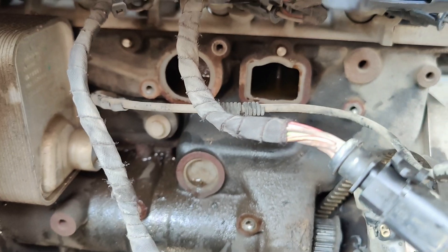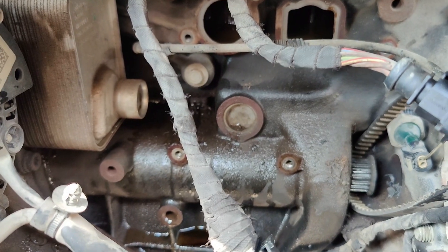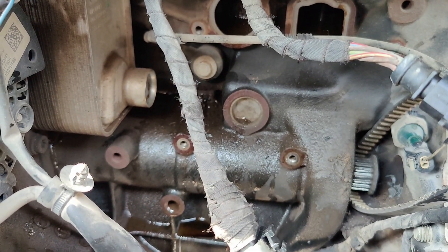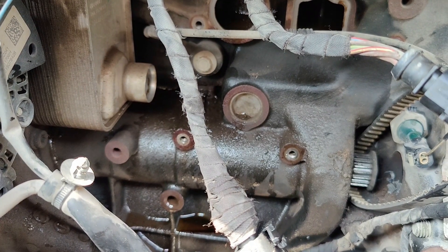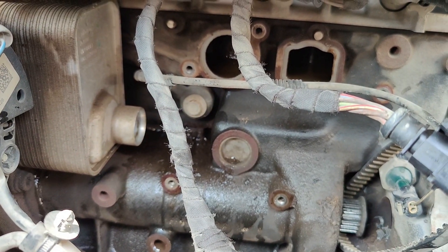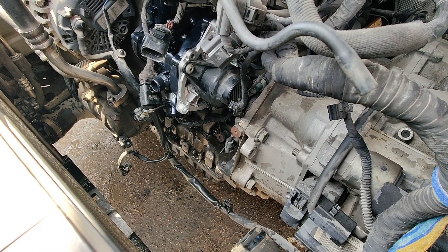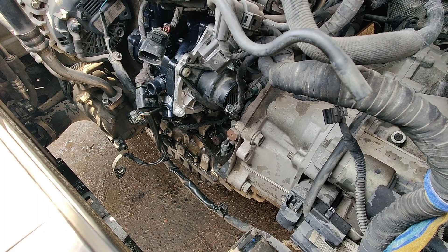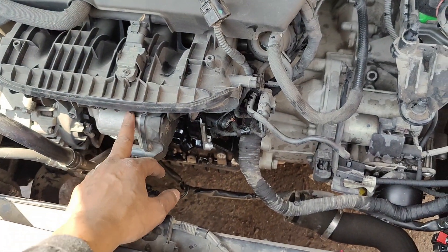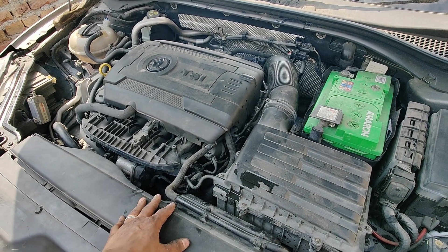The water pump assembly is out. We have to clean the contact surface around those two holes, then clean the inlet or outlet of the oil cooler, and place everything back in reverse order. If you want to clean something, it's a good opportunity to do that as well. My belt seems fine so I'm not changing it. The new water pump assembly is in — thermostat connected on the block and connected to the electrical coupler. Throttle body placed back in position, all pipes packed back, double-checking that everything disconnected is reconnected.